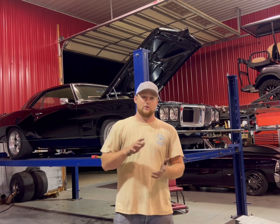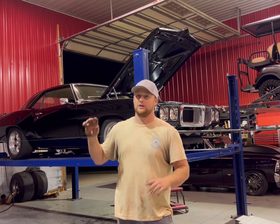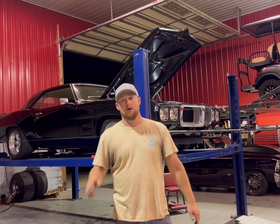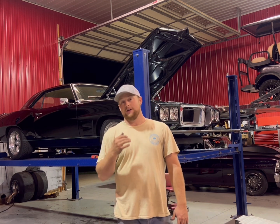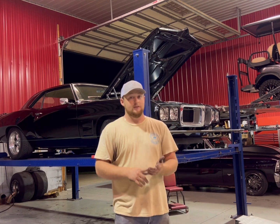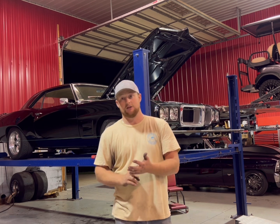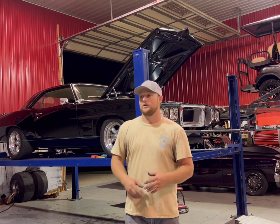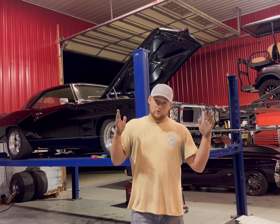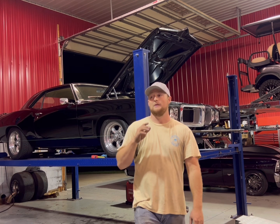The other thing I want to say, just to keep in mind when you're saying, hey, this is a lot of work, I don't want to do this, or hey, I can just take it up here and they'll align it for 30 bucks or whatever. They are not going to check all this stuff. They may check caster if you're lucky, if it's a good place. They may check camber if you're lucky and it's a good place. More times than not, they're going to get this thing neutral at ride height and send you out the door. And it happens all the time.